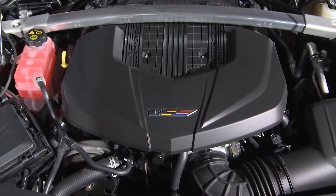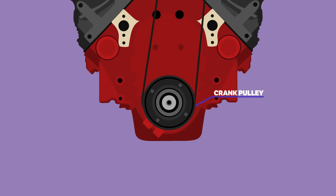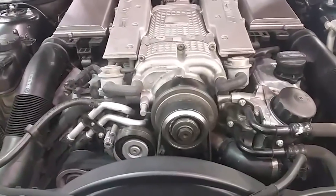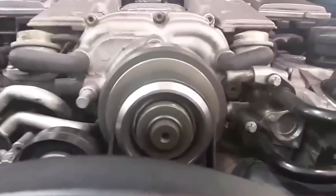When people talk about superchargers, you may often hear pulleys mentioned. We'll be focusing on the pulley at the front of the engine connected to the crank, and the one connected to the front or back of the supercharger. Essentially, without changing the blower itself, you can increase or decrease the level of boost by changing the size of the upper pulley.